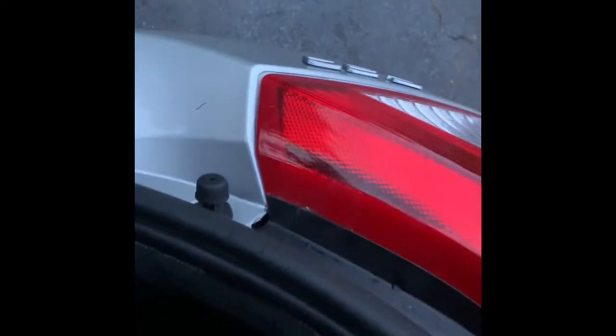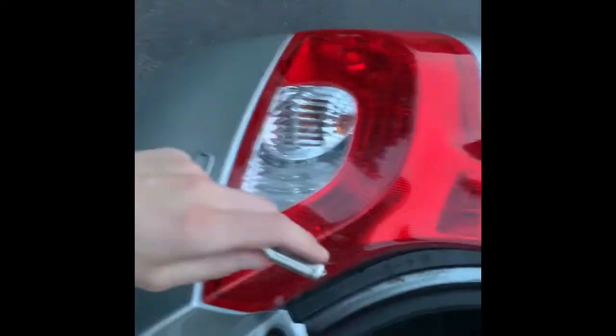Be right back. I actually just found a hidden bolt, and I figured out why my passenger side was so loose. If you come down here, it's actually right behind. I don't know if the camera can see it. It's right there, right where my light is. Right there. So I was wondering why the outer edges were moving, but this part was still stuck, which also explains why this side was loose when I originally took it off, because it's missing a bolt.